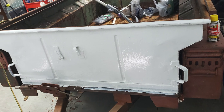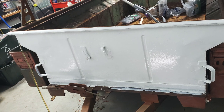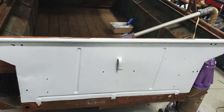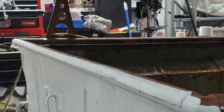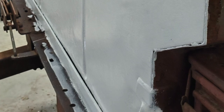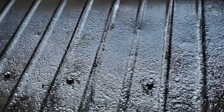After stripping the many layers of paint off of the tub, I had to put a self-etching primer on. I use a Rust-Oleum roll-on self-etching primer — all this in preparation for the final application of the roll-on bed liner. Inside the tub I use just a black roll-on bed liner, something you could pick up at your local auto parts store.